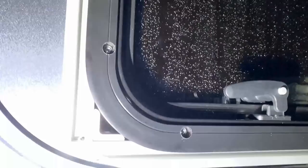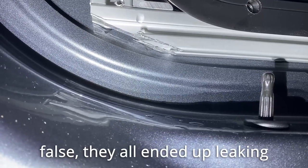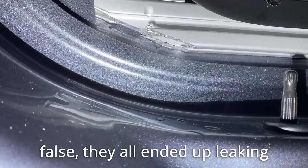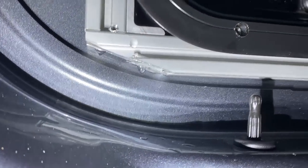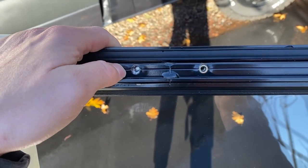It is raining outside tonight and we did a high-stakes water test. We actually do have one leak — it's extremely strange, about one drop every five seconds coming from one corner. Back out the next morning trying to diagnose the issue. First off, if this happens to you don't freak out — even if it's raining, the van panels are designed to drain water. The factory door handles actually leak if you spray them; water is designed to go in and drain at the bottom. I believe one rivet came out of its socket and that's the reason it was leaking.